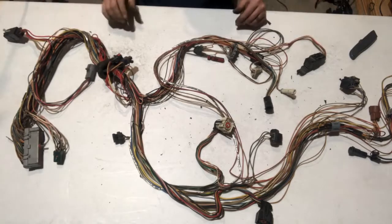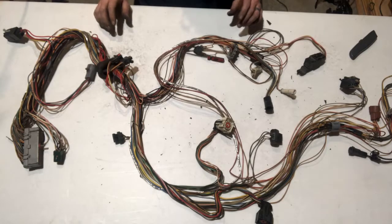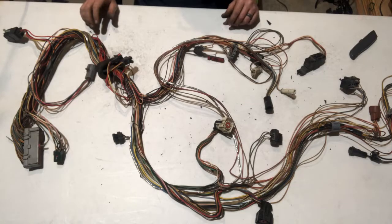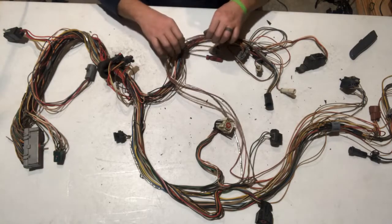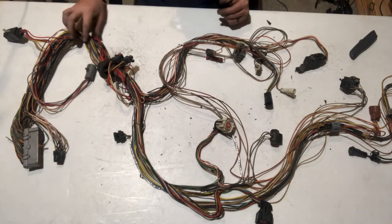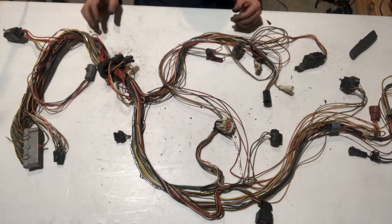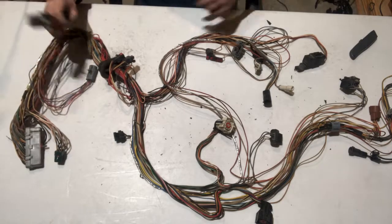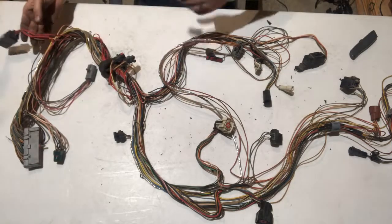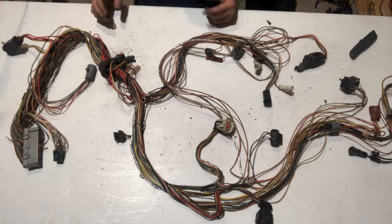After a lot of stripping, I've got the main harness all broke down. I'm going to stop this video right here and let you guys catch up to stripping your harness, and then we'll start the next one with labeling connectors and looking at the wiring. After you strip yours down, look over the harness pretty close — look for anything crispy, not flexible, broken, bare, or burned, because we'll need to fix that. It may not even be important, but it could be very important. If you find something, just wrap a piece of tape around it and write something like 'fix burnt wire' so you remember to go back and look at it. Get done with this guys and we'll catch you on the next video.